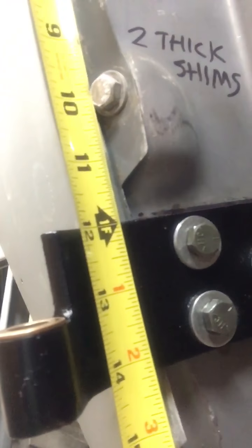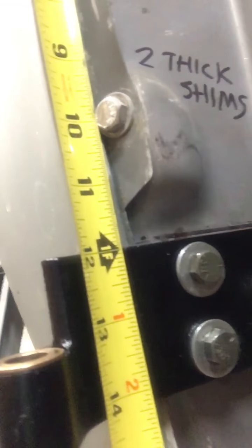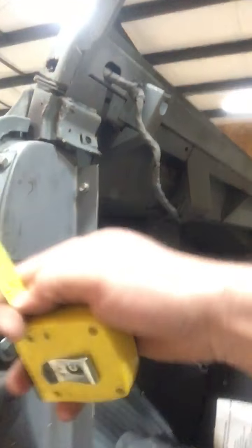Now, that's the easy part — obviously you take the old door hinges off. Something Michael showed me: when you install these, it's essential that the top of the hinge to the top of the hinge be either 12 inches exactly, or 12 and 1/16 inches exactly. That's so that the pins rest properly onto the bushings.